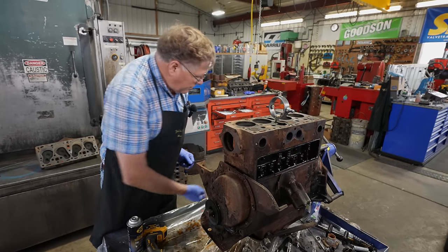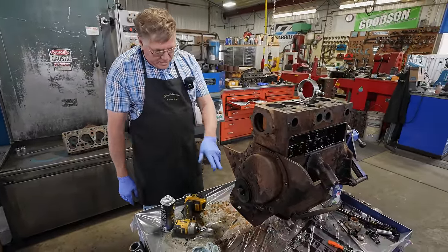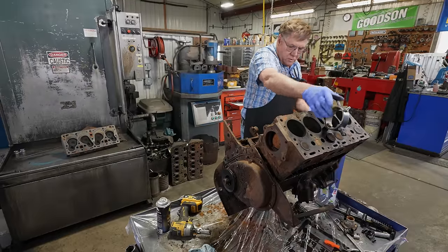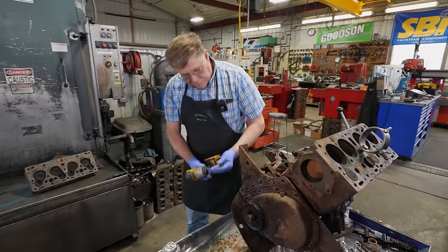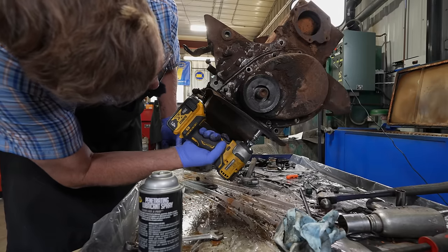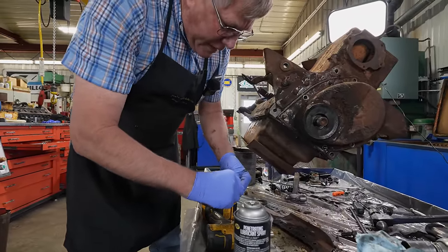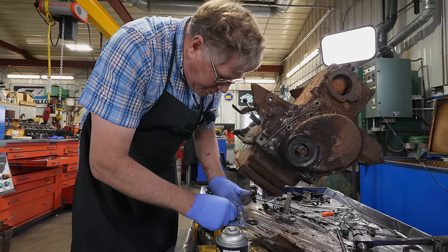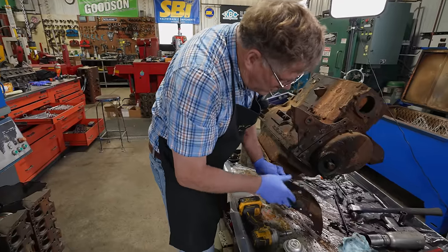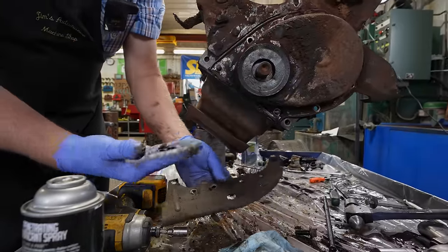Same thing here — bolt and nut with the star washer. We probably ought to tip this thing over and take the oil pan off before we try to pull that timing cover off. I'm going to roll this over just a little bit — I don't want to tip it clear over because I know there's going to be a whole bunch of oil and sludge in the bottom of that pan and I don't want it to end up in the top of the motor. Most of these little bolts just have lock washers on them. I'll pull them off so that when we clean the parts, they don't end up with steel shot packed up under the washer. Two of those the washer is fixed to the bolt, the other four came separate. The oil shield is now out of the way. Had washers for spacers between the oil pan and the shield — we'll have to remember where those go.